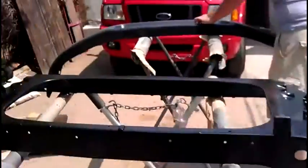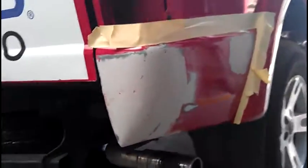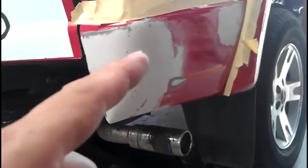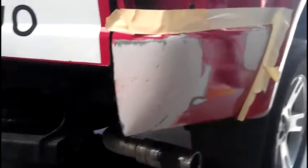I'm going to put some more filler on this red truck, the last coat, finish it off — 180 grit — get it primered up, see if I can have it painted by the end of the day. It's coming out; you can see I don't want to go beyond that line right there, just want to keep this section. This last coat right here should be the final. Looks good. The bumper also got repaired — doing the repair on it, put a little bit more on that corner.